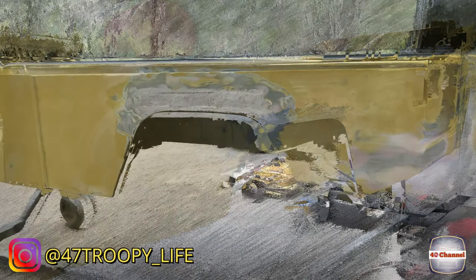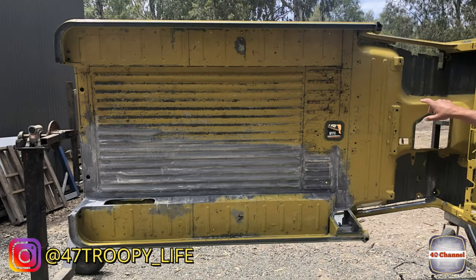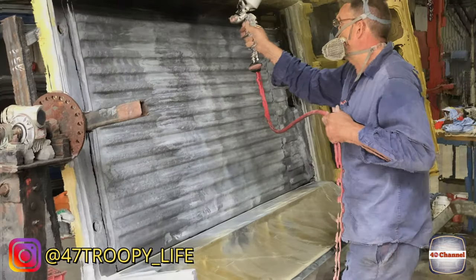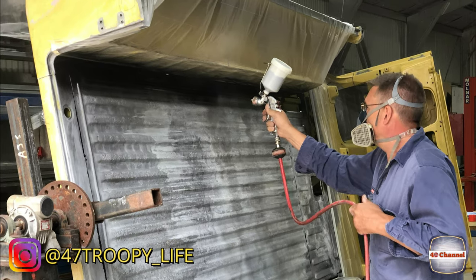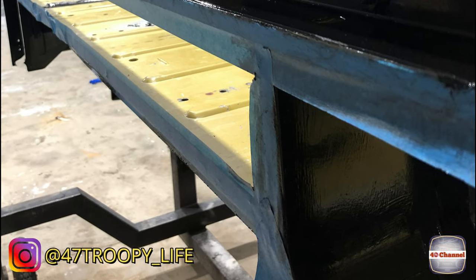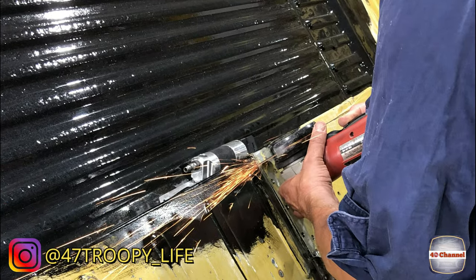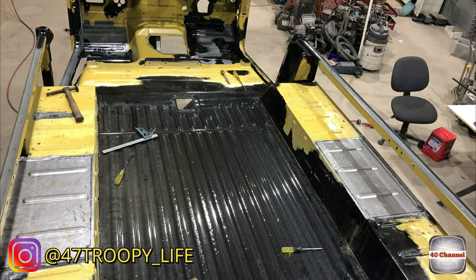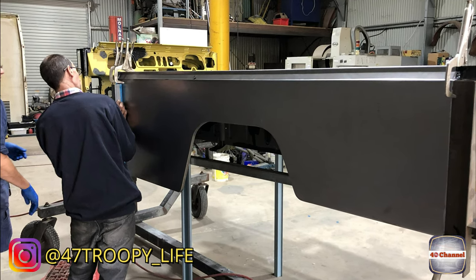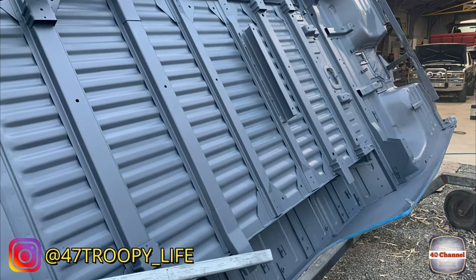The troopy saw some service during the recent floods at Tocahol in 2010, 2011, and 2016, as well as the usual beach runs where it became flooded up to the height of the driver's seat, ruining a hand-drawn paper tie that Seph had made for his dad. At the end of 2017, Seph had just got his L's and was daily driving his troopy. He decided to start cleaning up his grandfather's old troopy, taking off the roof racks and cleaning the mould off the roof before giving her a much-needed polish. Then fitting new rear diffs, front knuckles, new brakes, and bearings throughout. He put it on a hoist and got hooked into a proper restoration, stripping it right down to the chassis for sandblasting.